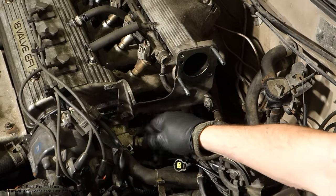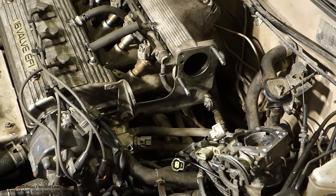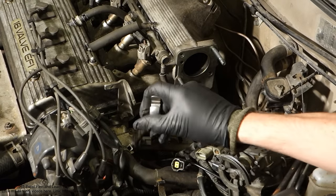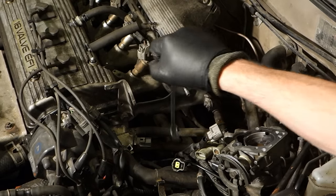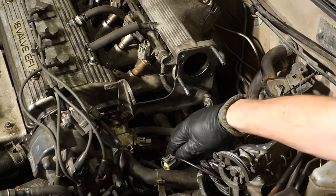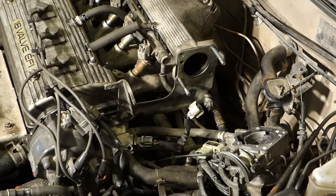And when we install this sensor back, it goes very easily because this is a specific metal. I only rotate that in that way, and then I take my tool, and if we have 19, I only insert that in here, and then I fasten that. When the length is okay, and now I believe that it is okay, we connect this temperature sensor cable back, and then we start our car engine and check that there are no leaks and everything should be okay, and this fault code 22 should also disappear.